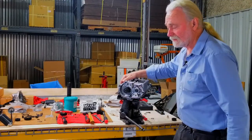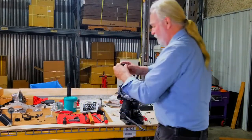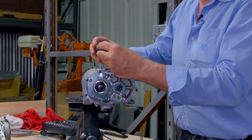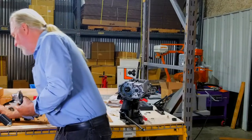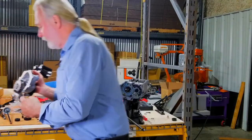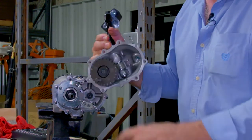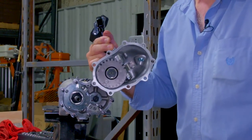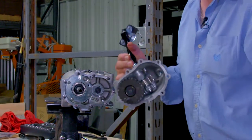That's what you want. If not, that'll allow your moving gear coming outward further, making contact with the striker plates and even the gear itself of your main kickstart gear. Not good. This is a check that must be done whenever you're installing a Kickstarter kit.